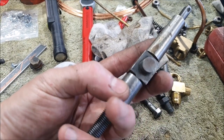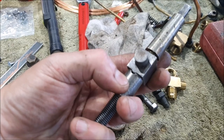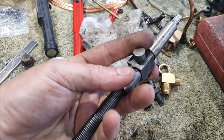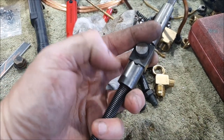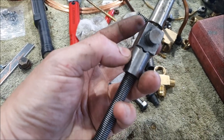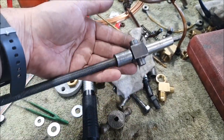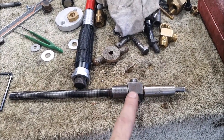There's the little step and the little indent that it fits into — that's what keeps the adjuster from moving. There's a little bit of tension on that when the brake cables are in place, and when you adjust it, that's what stops the adjuster just rattling around. I'll swap over to this one; I want to plate all of these first and I'm still waiting for my bits and pieces to come before I do that.